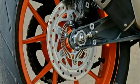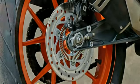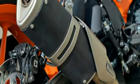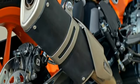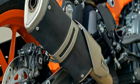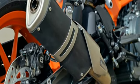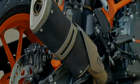The 390 does not feel very comfortable in lower revs, which might be an issue in traffic, but a final verdict on that will have to wait till we conduct our road test. Another feature which really makes the riding experience brilliant is the slipper clutch. While not a new feature, it is still very welcome. Hard downshifts are surprisingly smooth, with barely any rear wheel lock or squirm.